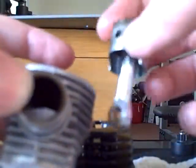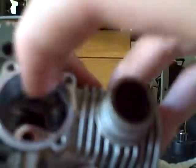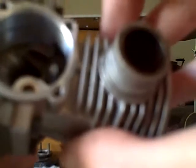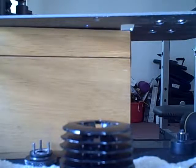Now, orient your piston with the cut edge, that side, towards, I repeat, towards the flywheel. That is very important. If you do not put that towards the flywheel, when the piston comes down on the downstroke, it will crack your piston, leading you to buy a new nitro motor, which sucks when you're just trying to fix it in the first place, or rebuild it just because it's just cleaning it. And I know it's tempting to use tools on this part, but just use your fingers. It's way safer. If you use any tools, you risk scarring.